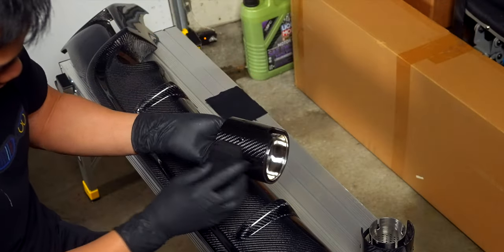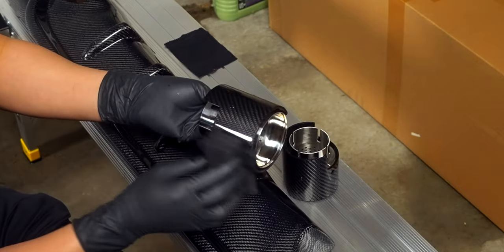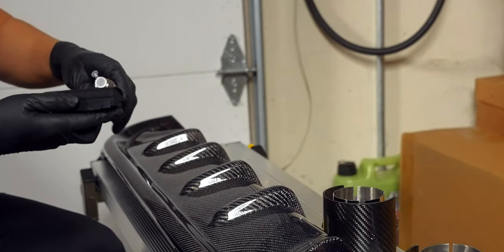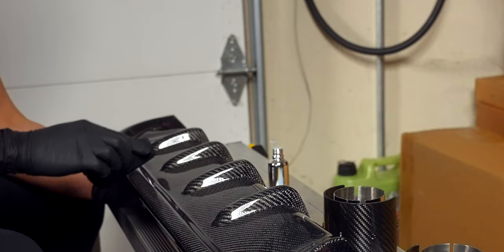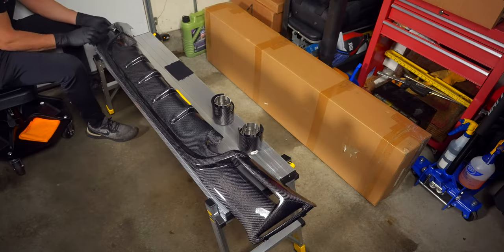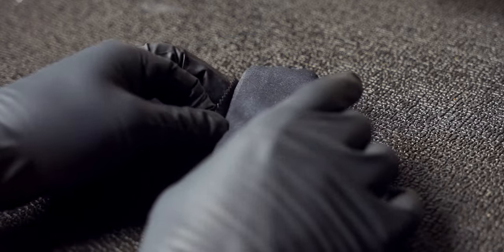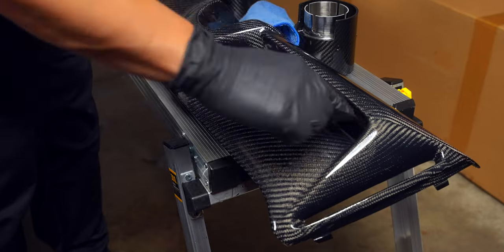You should be able to see the coating on top of your carbon fiber as it's being applied, as well as feel a moderately smooth motion. Too smooth or running ceramic coat means too much, while a rough, grabby motion with no visible top layer is a sign that you need to add a few more drops, but not as much as your first application. Once we've spanned the entire piece, the microsuede should be saturated with the ceramic coating, so we can remove it from the block and use it directly to attack those tight spaces from earlier.